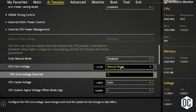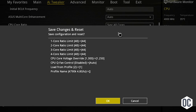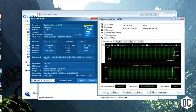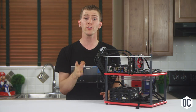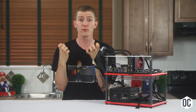Now that we're familiar with the settings, it's time to overclock. We'll start at stock voltage — 1.25 volts — which is different from auto, which scales voltage as you increase frequency. Then we'll turn all core multipliers up to 44, giving us 4.4GHz — equal to what Turbo Boost does on its own, but let's see if it can do it all the time. Press F10 to save, boot into Windows, and run stability tests. If it passes a 5–10 minute stress test and temperatures are acceptable, go back to the BIOS and push further. If it fails, add a bit more voltage. This process helps you find the balance between chip longevity and the extra performance you crave.